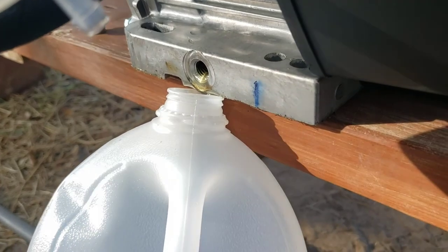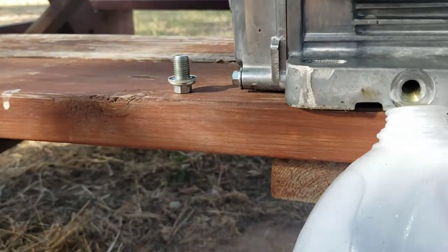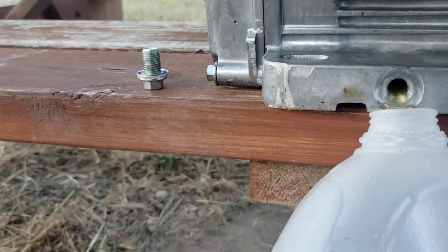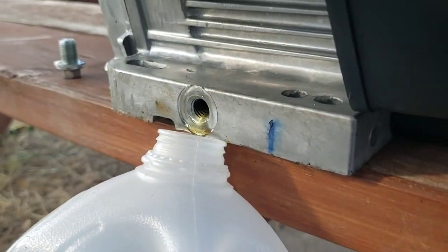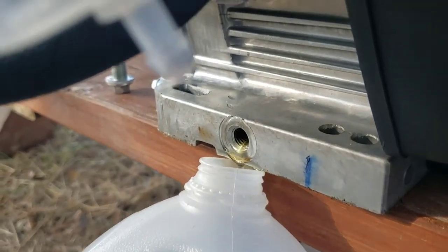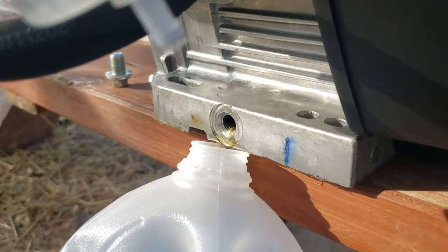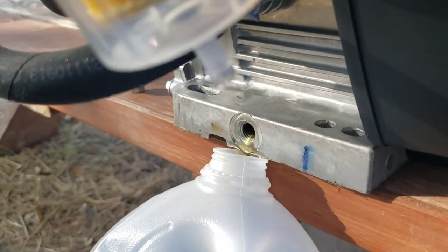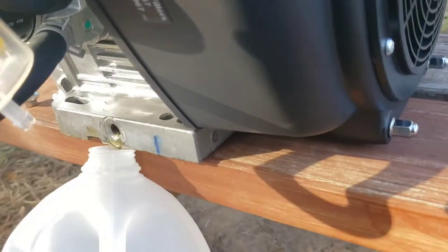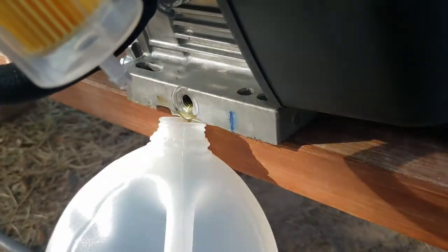I don't think there's going to be a use for the washer. It's a 12 millimeter bolt, and that's for both sides. So it's got the bolt and the washer. So just wait for this to finish draining out, and maybe if I'm able to on my own, tilt it a little. Then we'll add the extension tube, change the filter on here, mount it up on the skid. And then prep her with some oil, and I think tomorrow we'll go ahead and do the break-in.